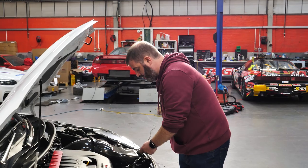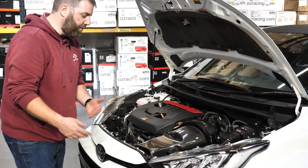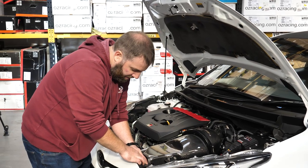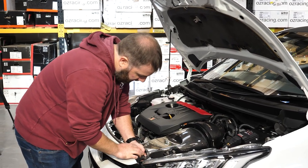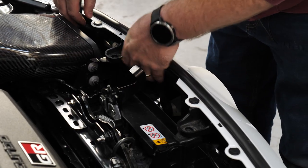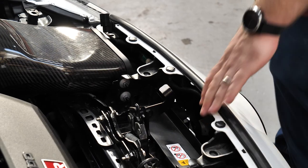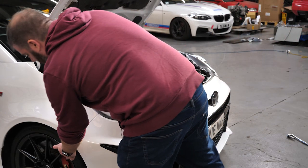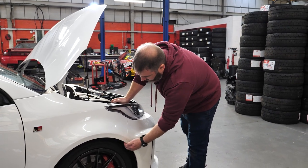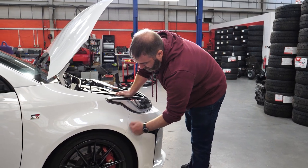Some people say you can take this bit of black plastic out from behind the bumper and do it all that way; however, like I said, I'm not going to be able to show you anything if I do that because all you'll see is my arms in there, so it's quicker for me to just take the bumper off. We've got one connector here for the front badge which has the camera in it. Your air box won't be in the way if it's standard, but mine is, so there is another connector here, but we don't need to worry about that — it's just this wire by the passenger side headlight you need to undo. The next thing is just a couple of screws joining the bumper to the wing — we're going to pop the trim clip out from behind here, peel that back, and expose that screw.